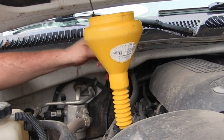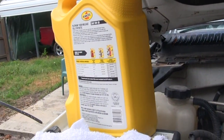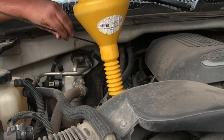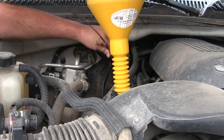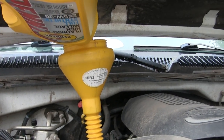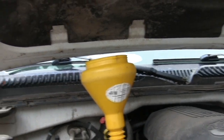This is really an easy oil change. My Titan, you have to remove a skid plate, but you don't even have to do that with this truck — everything is easy to get to. You could probably get under this without ramps, but if you are using ramps, be sure to put it in park, put your emergency brake on, and block the back tires. You don't want it to roll off — always follow all the safety precautions.